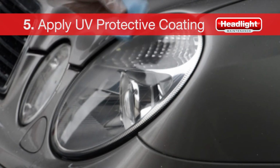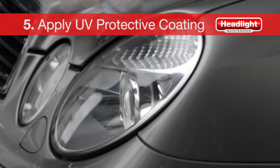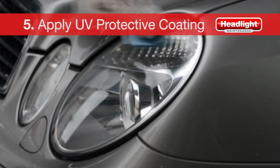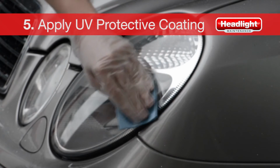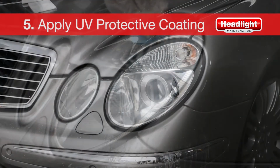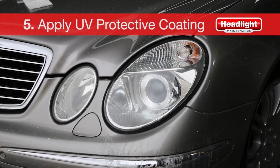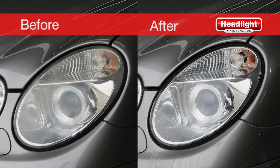Coat the lens quickly and avoid excessive wiping, as any streaks from wiping will self-level. We recommend allowing at least 1 hour drying time. However, depending on the climate conditions, drying times may vary. If you have accidentally applied UV clear coat to the paintwork around the headlight, simply remove it using a basic rubbing alcohol.